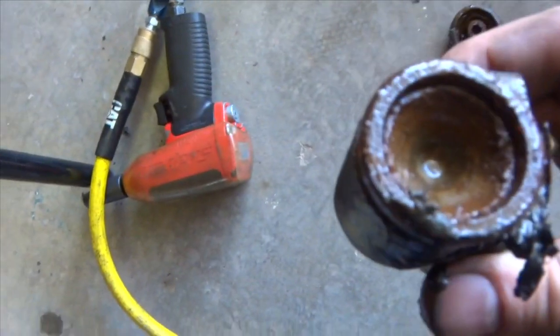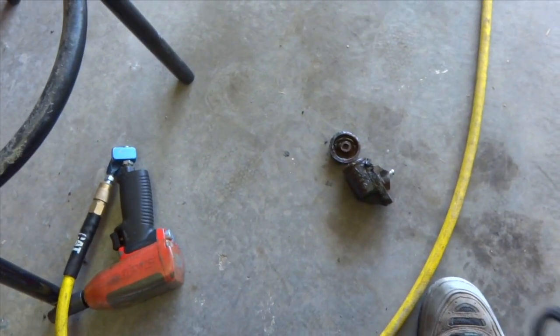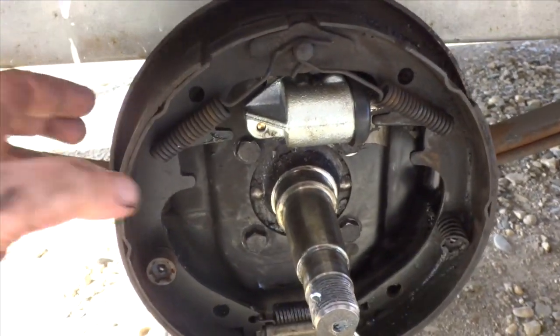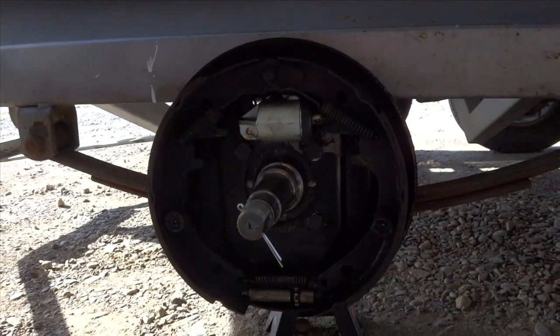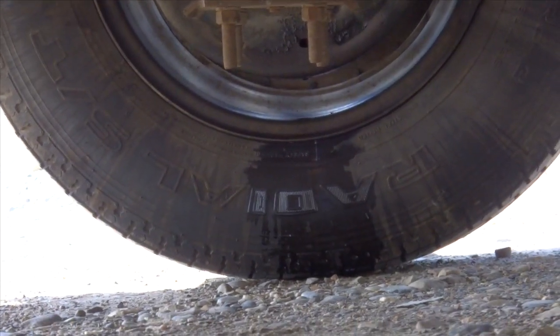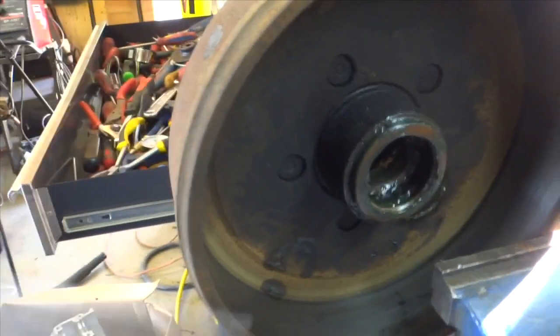You can see right there it's been leaking fluid — I'll probably have to change all of them out eventually. Here's the new wheel cylinder going in. Got the back brake drum cleaned up and everything else ready to put back together. But never fails — always something. When we first did the brakes this wheel cylinder was leaking, and now on the opposite side that wheel cylinder started leaking too. Why can't they both start leaking at the same time so I could order parts together?